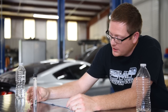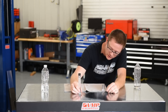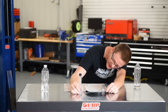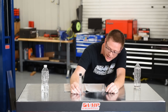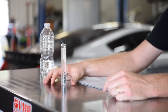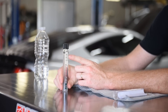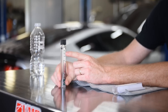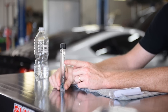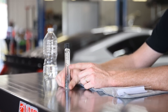We've let this sit a little bit and you can see there's a very defined line of separation — we've got some pretty good E85 here. It looks like it's about E90, E91, maybe E92 — somewhere in that area. This is some pretty good stuff from the local station. Obviously if you got into some winter blends, your line would be down lower. Here's your traditional E85, your 80, all the way down to E70. If you get down to the bottom here, this is your 50s and 60s — probably don't want to use that.